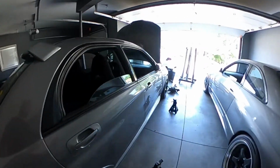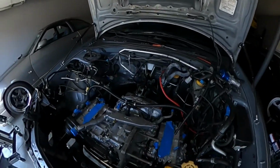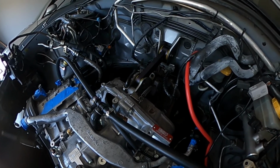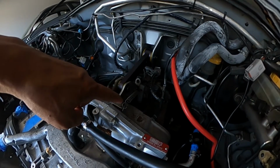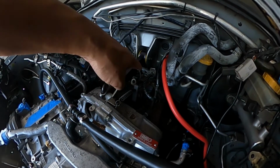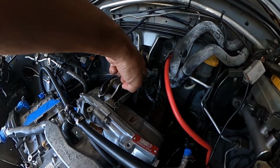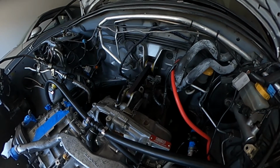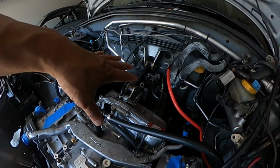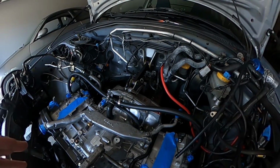I did a little bit of installing last night. I put in the clutch slave cylinder, and all I had to do is really attach the spring back to the fork. There's two bolts underneath that slave, and made sure that this thing was hanging. I guess I needed to clear some room when I pulled out the motor initially. But that right there's a 12mm bolt that I undid and bolted back. Anyway, the slave's all good. Tried out the clutch. Feels just like stock, so I'm pretty happy about that.